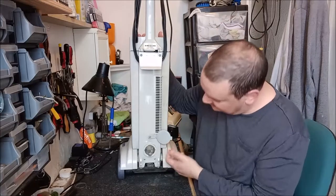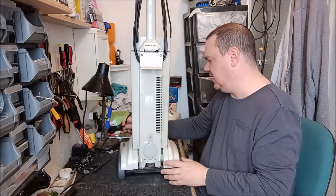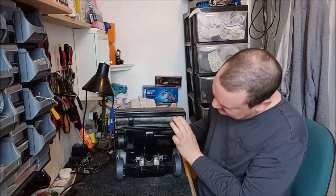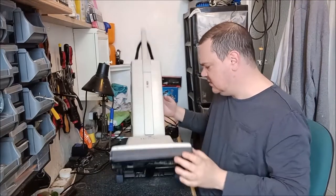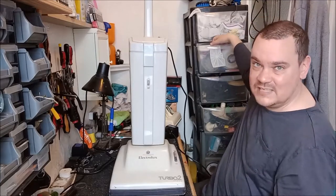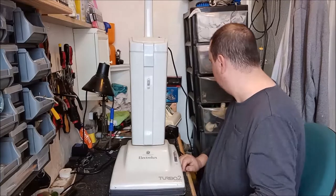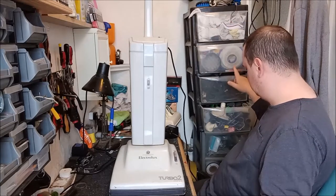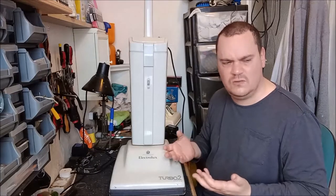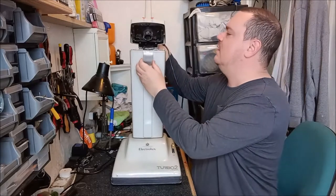If I give it a good fingering I can feel the suction there, but it's obviously blocked at this point. Where the lower hose runs down through, it's blocked up. And I think it needs a new belt as well — look how slack that belt is. That definitely needs changing. So let's start taking it apart. I think we're going to need some new filters — look right here, there's a lower cage filter that goes down there. We might have to clean the other filter that's in there too.